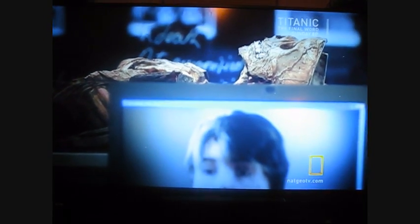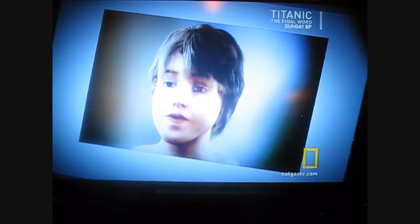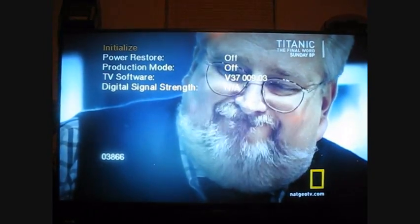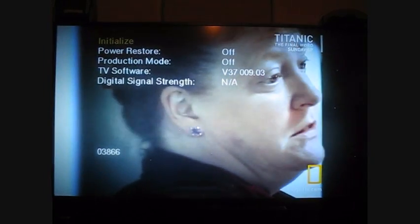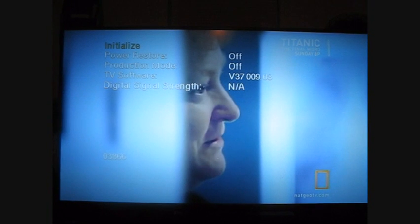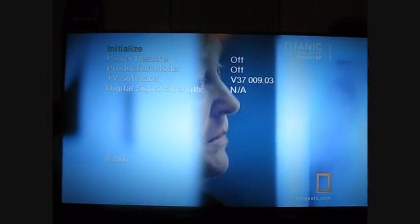While I'm at it, I'm going to check on replacing the lamp too, because I'm not sure how many hours are on it. There is a code to check that - I believe it is menu 2470. It worked, and it has three thousand eight hundred and sixty-six hours on it, as you can see in the lower left corner. That's a lot of TV watching. Still a good picture but I'm probably going to go ahead and change it anyway.